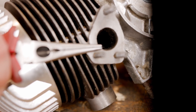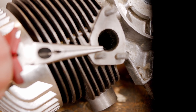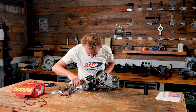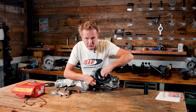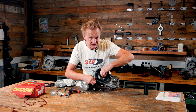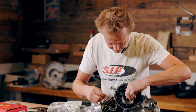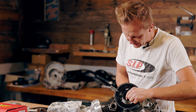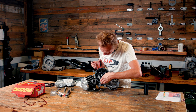Now the duct is open. I can move the piston to it and then I can rotate it — and again it's closed here. So this will work. Now apply the degree disc. The only thing I must be sure is that I'm reaching the very low position when the piston starts to open the intake duct. And then when I think I've found this position, I calibrate the degree disc to zero at that point.